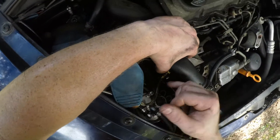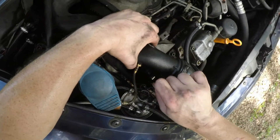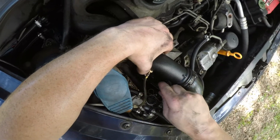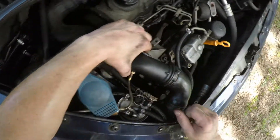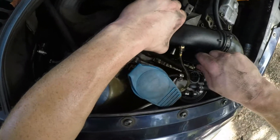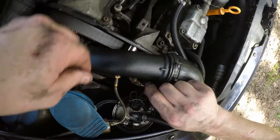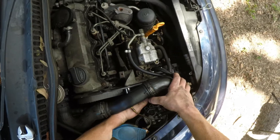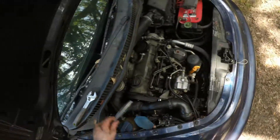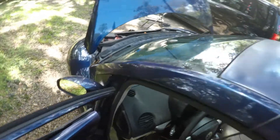What you're doing is: the bolts are attached to the cog wheel on the timing belt, and the nut you're turning is the actual shaft of the injection pump. So you're changing the relationship between the cog/pulley and the actual shaft of the injection pump. This is only something you need to do on mechanical diesels — on anything after about 2005, you don't really need to do this anymore because there's not much mechanical anything as far as diesels go.